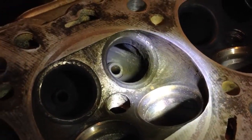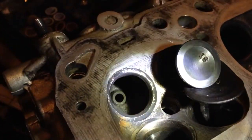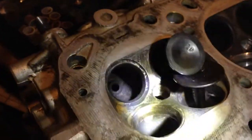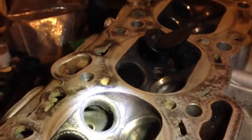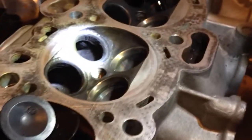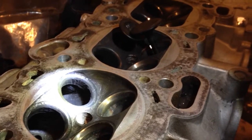As you can see here, these are still not very clean, but I just chipped out most of the carbon out of in there. I'm still working at it. What causes it — these two aren't cleaned at all, you can see a little bit of a difference. What causes it is carbon buildup. That could be one of the causes. Another cause can be corrosion of the valve seats, and another can be corrosion of the valve itself.